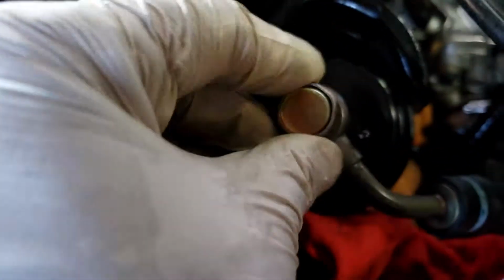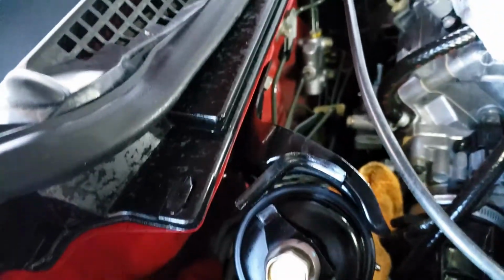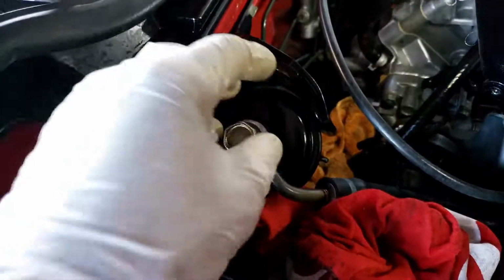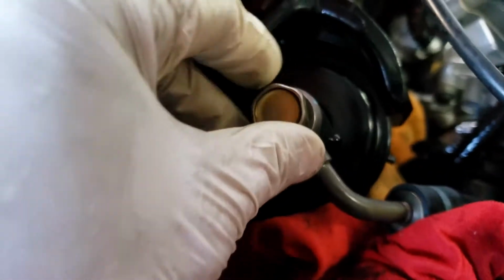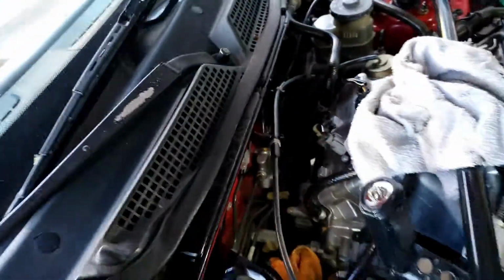If you can get this bolt loose like this, make it loose a little bit and slowly let the pressure come out. Okay, if any fuel comes or squeezes out, you have a rag under. Okay, so let the pressure go out first. Do not do anything. Okay, now when you break this loose, now the trick is this is the trick.